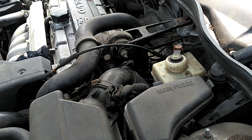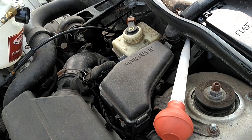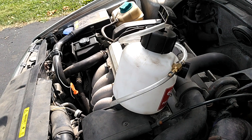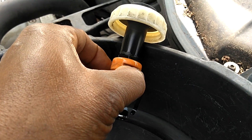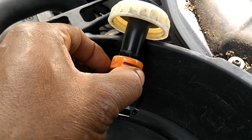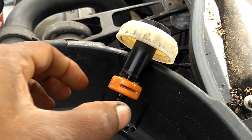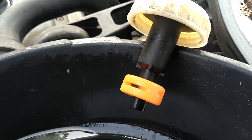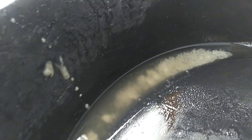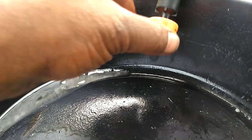Going to kick it off with the brake power bleeding. As you know, last night it failed the test. Got my turkey baster here, sucked that old fluid out. Then I got my power bleeder — going to get some fresh fluid in there. Brake fluid, the float was stuck in the up position. Got to get that gummed out so that it drops. If the level drops, it'll give you a light.